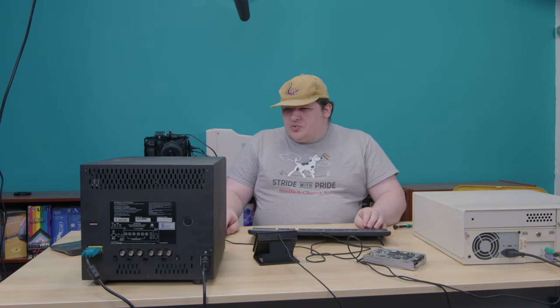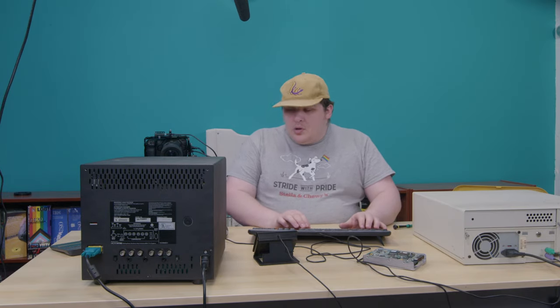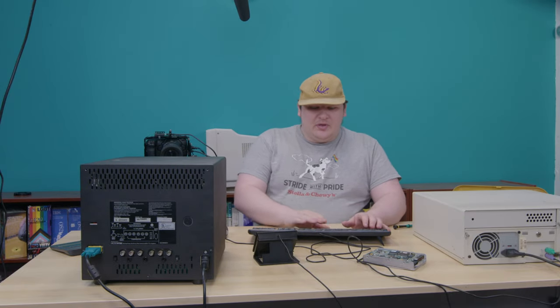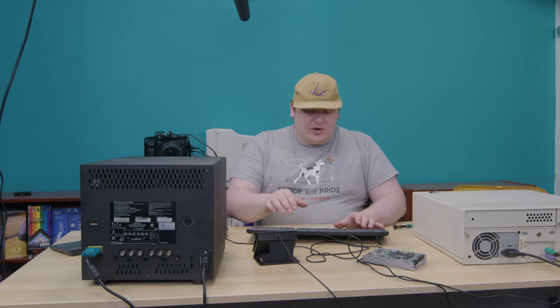But there's a reason I'm here beyond this. See, this is not working as intended, but apparently it can. The VGA obviously is all messed up. But people say that if you take the EGA driver out of Windows 3 and you put it into Windows 98, well, they say this for 95, I'm not sure about 98, but if you replace the basic VGA mode driver with the EGA one from Windows 3, supposedly it works. So we're gonna give this a shot.